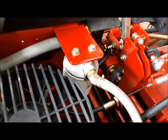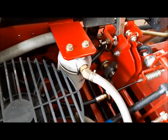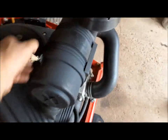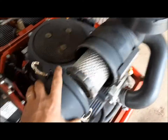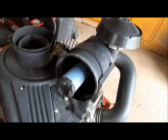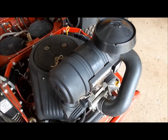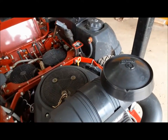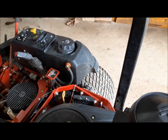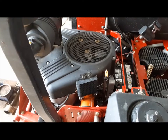There's the filter I'm waiting on — I ordered it. It's the hydraulic filter. So we'll change that and put new hydraulic oil in it, but the filter's not here yet. She's all greased up. Now we're going to have a look at the air filter. This has a dual filter — a primary and a secondary. Here's the primary. Usually just pull this out and give it a good blow. There's a secondary in there that's literally good for the life of the machine. This is the filter that you change or service. We're going to give it a fast blow and put it back in. The air filter was pretty clean, not much came out of it. The engine oil and filter — we're at our 250 hour service — isn't due until the 300 hour service. So we've got a little ways to go before we get to that.